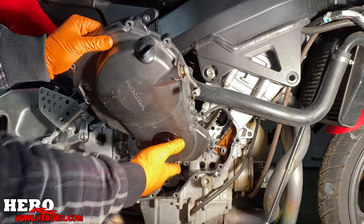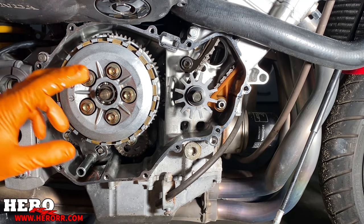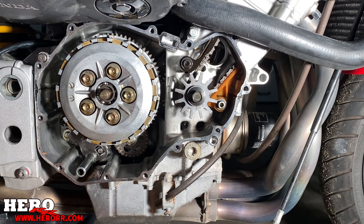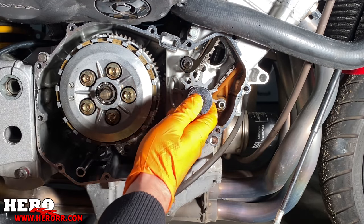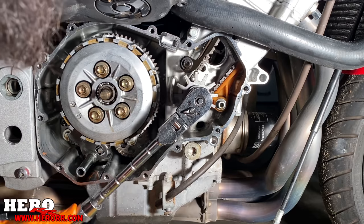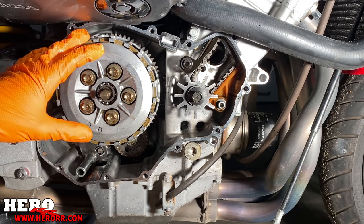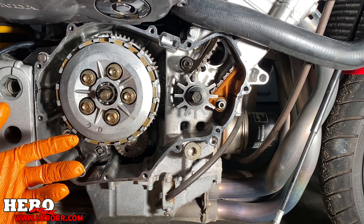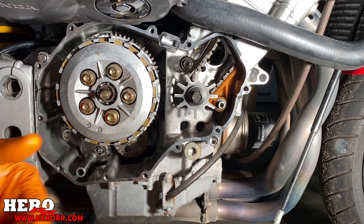Okay, just got that cover off. So I'm in here now and I'm just inspecting everything because I heard a weird sound from this area — I don't know if it was the exhaust rattling or whatever. I'm checking all these little teeth in here, making sure they're good. If I turn this I can spin it and inspect all the teeth to make sure nothing looks broken. So far it does look all good in there.